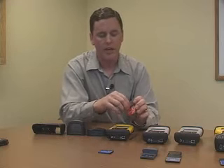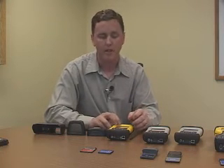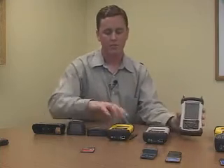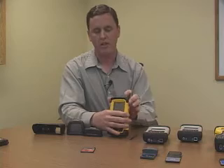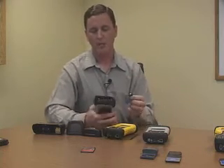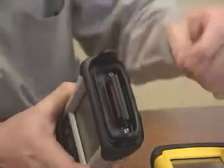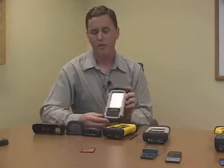You can get the Recon X with built-in Bluetooth and Wi-Fi from the get-go. But if you didn't purchase your Recon with those capabilities, you can always buy these cards and add them in later on. It's really easy — this is how the Recon comes to you. You basically take off this cap, put on the modified base, and then just pop your card into either of the two compact flash ports right on top. Pop it in, install the driver, and you're ready to go.